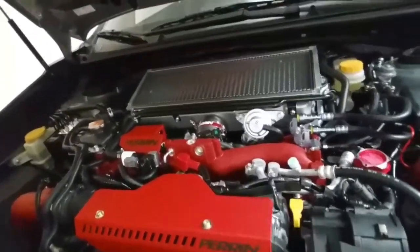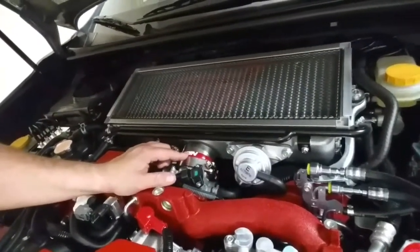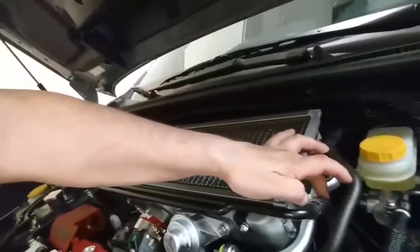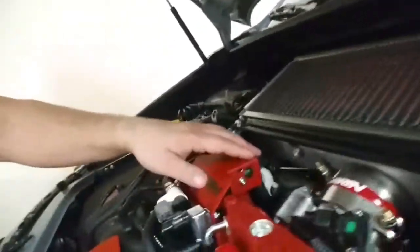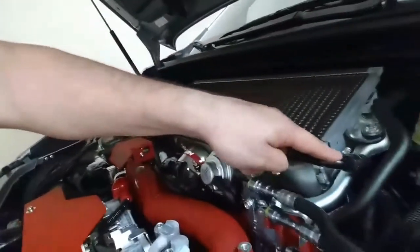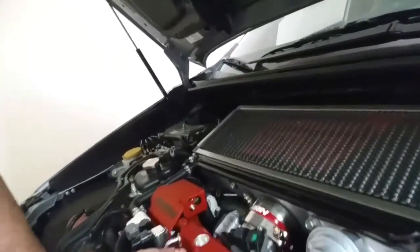And we're back. This is the coupler right here — went ahead and got that put on, wasn't that bad. Had to take off the intercooler. There are four bolts holding it — one on this side, one on this side, two right here. Got to take off these two bolts for the blow-off valve. And then there's these two hoses right here and this other inlet hose over here. Then this thing just wiggles right out. I'm not going to lie, it was a pain in the ass to put in.